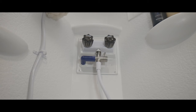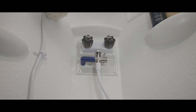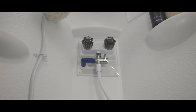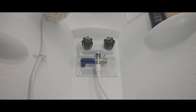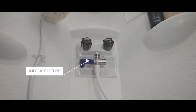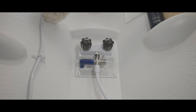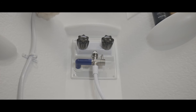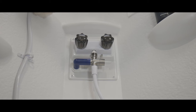Here in the shower, we have the shower miser. This is designed to recycle the shower water while the water is heating. There are three modes: the first mode is off, meaning that no water will flow. Next is bypass mode, where the water will pass through the miser and recycle until the water is warm — the water will be warm when the indicator turns from blue to white. Finally, you can turn the miser into operation mode, which will stop recycling the water and let it flow from the shower head as normal. Please keep in mind that using this feature is directing the water to your fresh tank. If you are connected to a city water connection and using the shower miser, you'll be filling your fresh tank. We strongly suggest only using the miser when you are dry camping and need to conserve water.